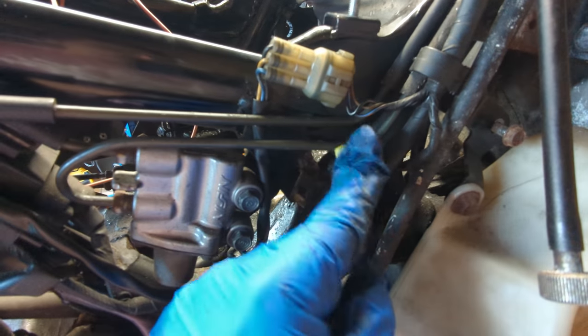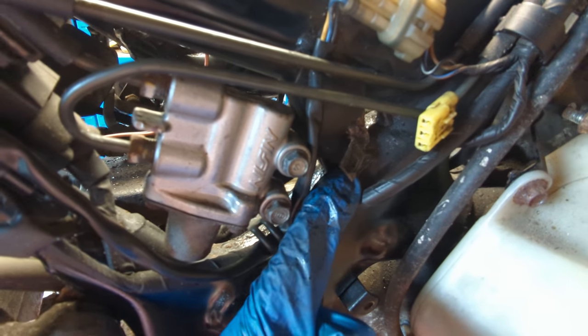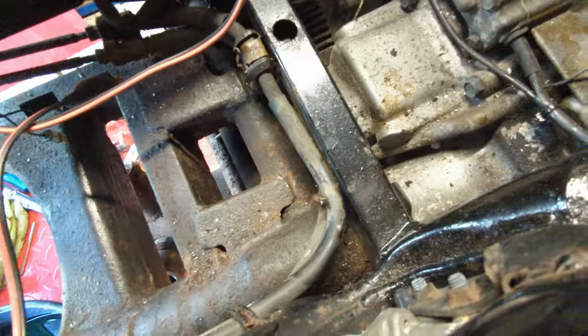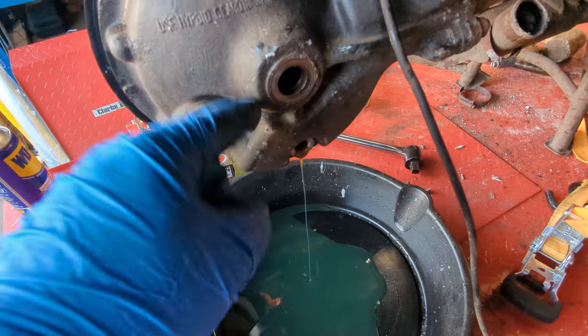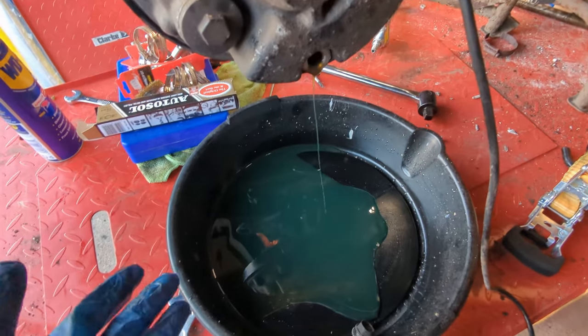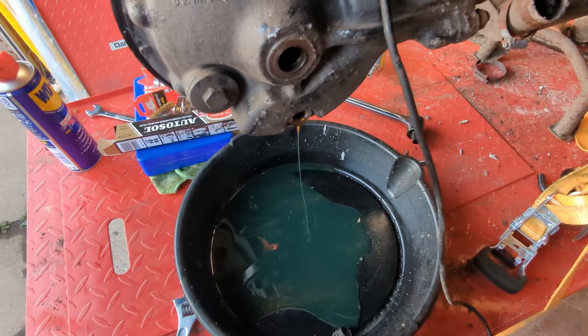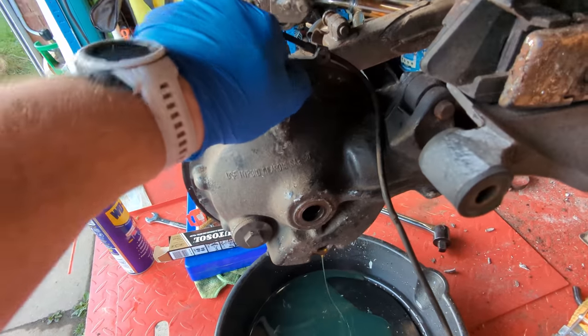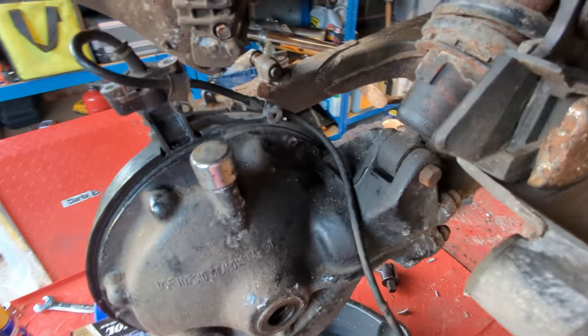Pinch in this bit on this side and then you can ease the other side out. Stick a screwdriver up it this way to a little clip, push it - that'll pull off. It goes through there, over there, and down the swing arm. While that's going on, I've got the oil draining out of the final drive because we need to check that anyway. Looks like it was in immaculate condition but better safe than sorry, and after that we should be okay to undo the shock.